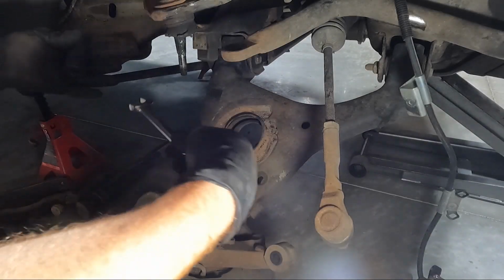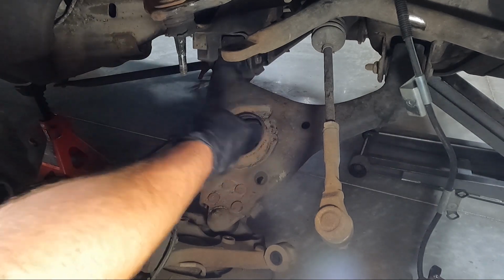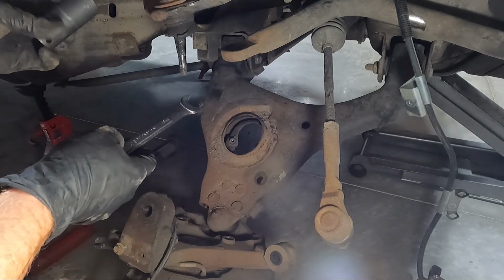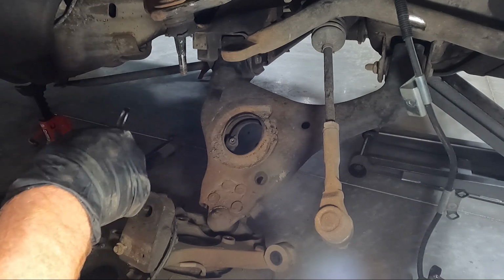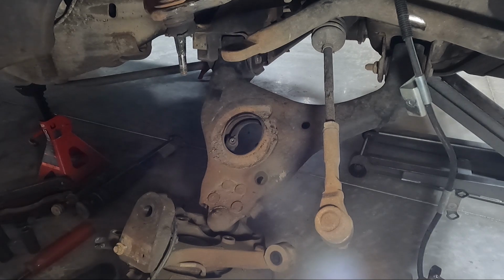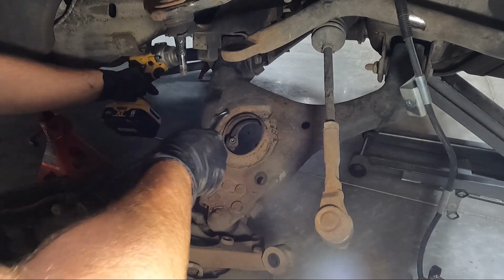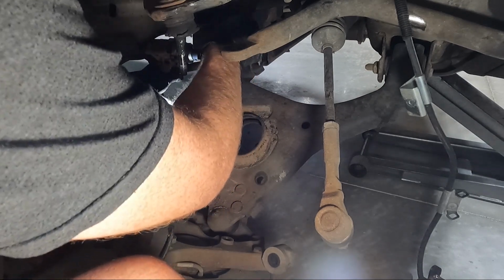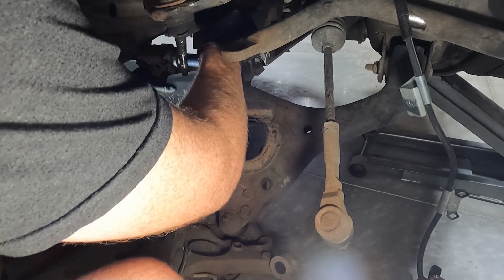These have a nut on the, closest to the back, and they have a bolt coming through. The bolt head itself is an 18 millimeter. The back, I'm sure is metric, but 13, or actually 15/16 fits it really nice. So that's what we are going to use, because 22 is actually the deepest metric that I have. So we'll see what happens. These are going to be tight. That's impressive.